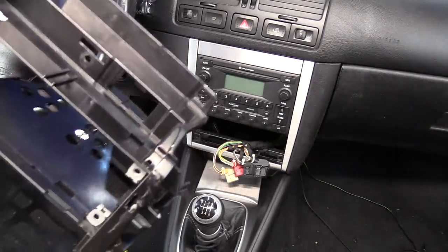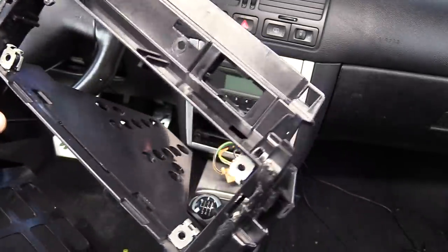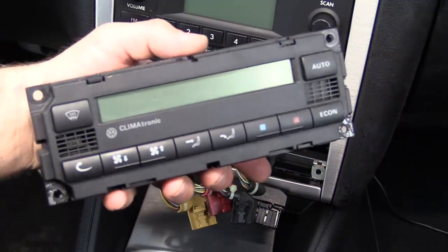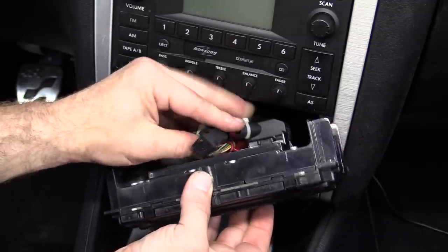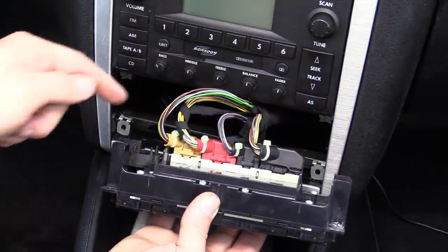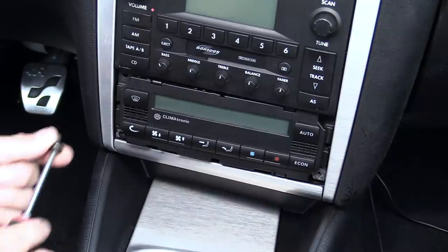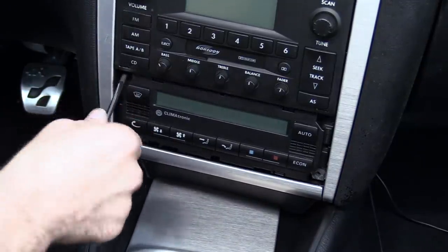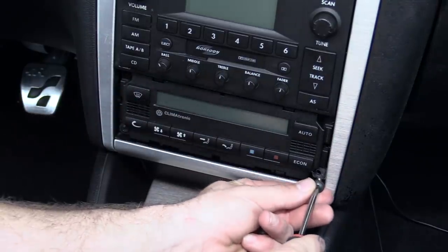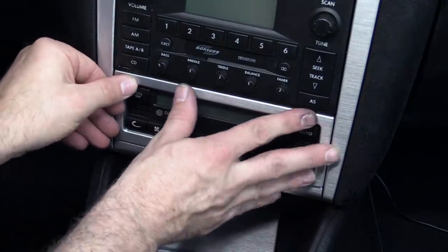We need to get our AC control head in, but first we have to swap these little screw retainers over from our old bezel to our new one — probably something you want to do before you put the new bezel in. Take a pocket screwdriver right at the top and just pry them out, then put them back in: one, two, three, four. Now take our control head and plug it in — the plugs are all different size connectors so you really can't get it wrong. You have tan, red, small black, big black. Set the control head in its location and screw it down by hand, since we had broken ones — we don't want to cause any more broken parts. Be extra careful with the one we glued. Finally, install the trim around the Climatronic — that just snaps right on.